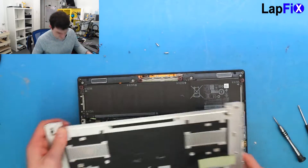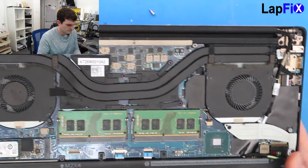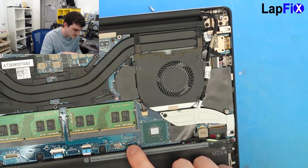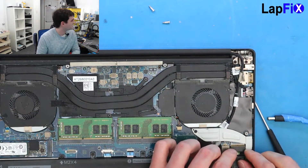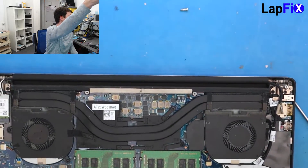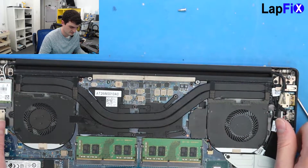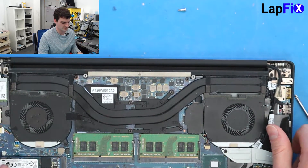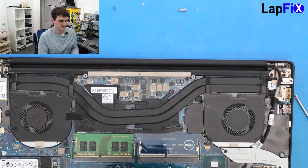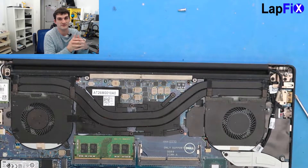Let's go check the board and see what it looks like. I do actually see something here, so let's unplug the battery. Sometimes when it turns on with no display, one of the good things about this model is — especially compared to a lot of new devices — they usually have RAM that is soldered in. So maybe it's just a RAM issue; there are two slots here, so we actually have a much better chance. Let's try removing one. It is heating up — maybe it's a bad RAM slot. Most of the newer ones do come with soldered RAM, which makes it more difficult to even run this test.